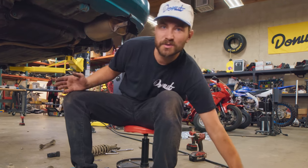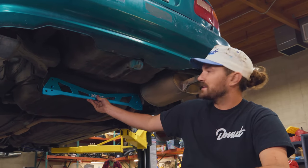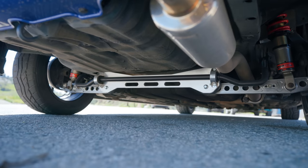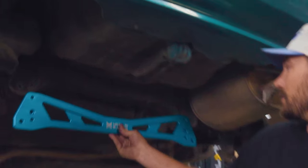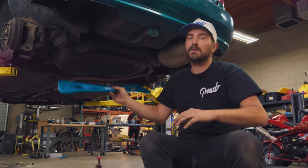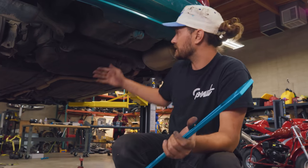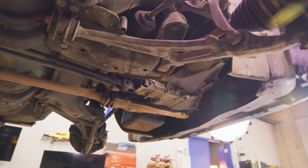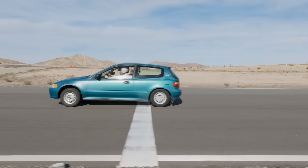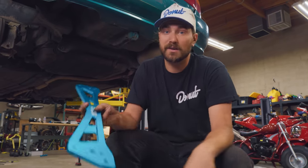The thing I've always wondered about is this dang bar. This is one from Megan, but there are many like it — you always see them hanging off the backs of Civics and I never knew what the purpose was. It turns out it's got two purposes. First, this is our rear subframe and it's pretty flimsy, so this bar helps reinforce and strengthen it. But it also does a second thing: these cars, especially lower trim models, don't have sway bars at all. This car doesn't have a sway bar front or rear, but adding this in the rear gives us places to mount a sway bar. Since this is a front-wheel-drive car with some understeer, adding a big sway bar to the rear will allow us to dial in a little more oversteer and make this car feel a lot better.